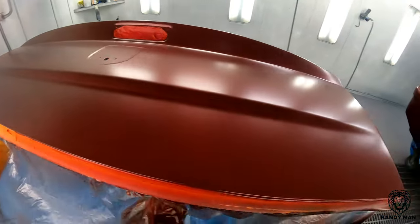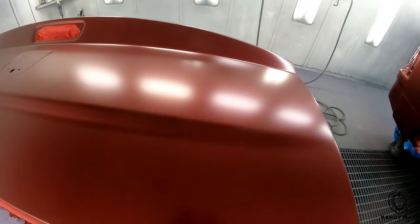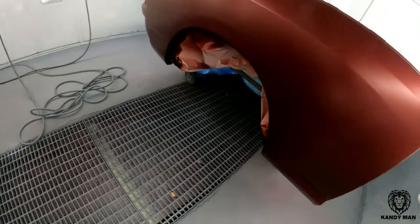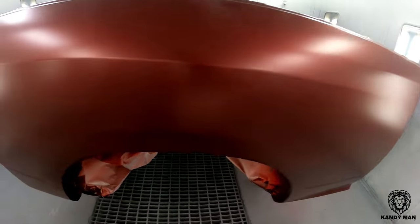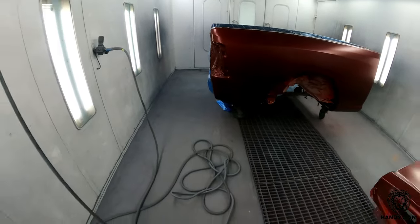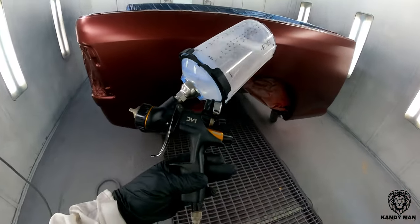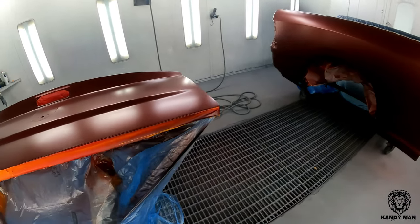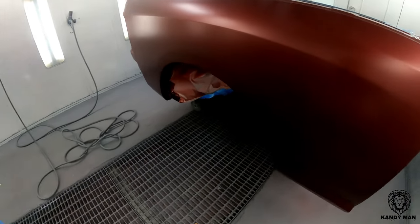It's all covered and you can see it definitely lightened up after three coats. I was using the 3M gun with the 1.2 head and put down three medium wet coats. I don't really do a control coat too much on these reds — there's no real need for it. It's going to pop real hard when we hit it with the clear. We're breaking out the DV-1; it's been a minute since I've cleared with it, but we're clearing this one with the DV-1 using the C-1 cap at 24 PSI with the 1.4 head.